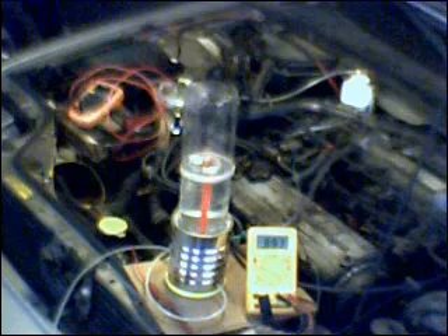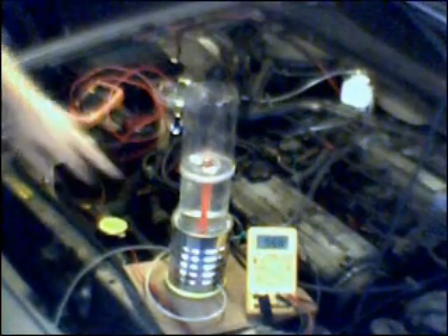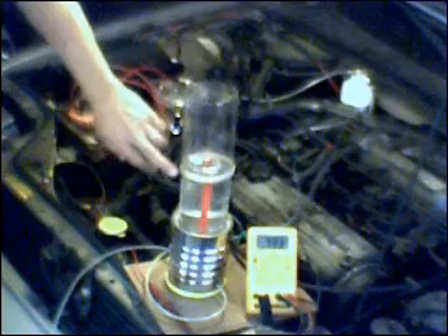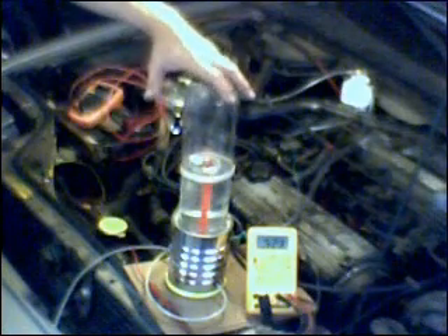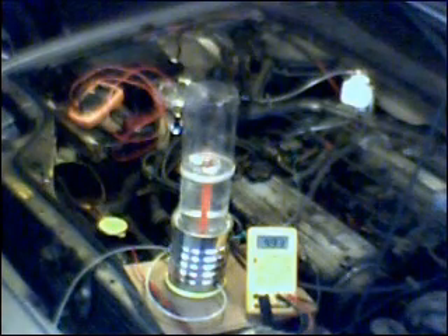Down here are the two full-wave rectifier bridges that take the two separate AC outputs of the transformer and rectify it back to DC. It is filtered with these two capacitors and adjusted with these two potentiometers. The way this is attached to the vehicle is it is inserted in series with each of the oxygen sensors, and each oxygen sensor is calibrated independently. The cell right now is cold. I've made one small modification to the gas collection device — I've taken a 2-liter soda bottle, cut the sides off, slid it up, and wrapped it around the existing column so that as the 500-milliliter bottle rises inside, I don't have to worry about holding it in place. It can just rise on its own until it starts to bubble through, and it works extremely well.